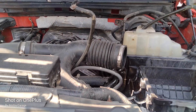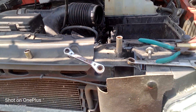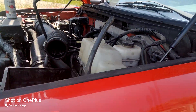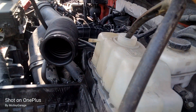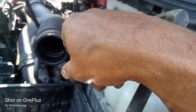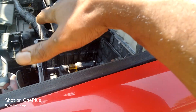What's going on Motley Garagers? Today I want to say happy 4th of July, but this is just a quick little vlog video. I'm working on the F-150. I got the idea because you guys know how the truck shuts off and says low oil — I'm gonna change the oil pressure sending unit switch, which is right in front of the turbocharger. So I got to take the airbox off.